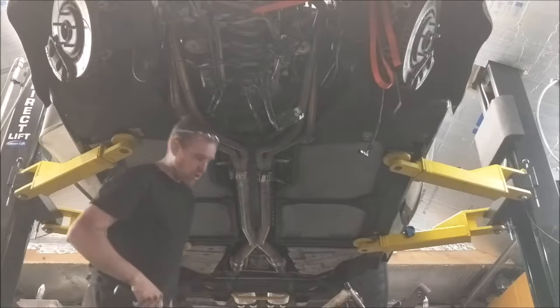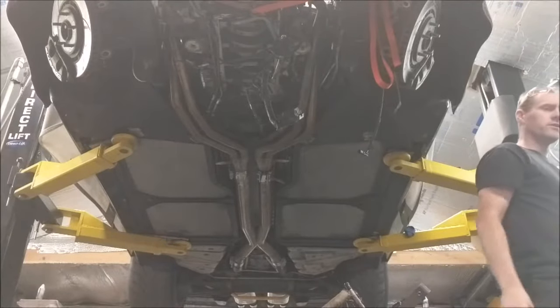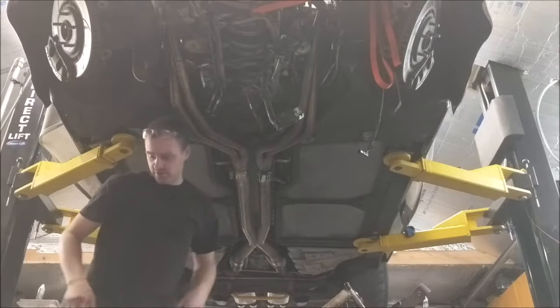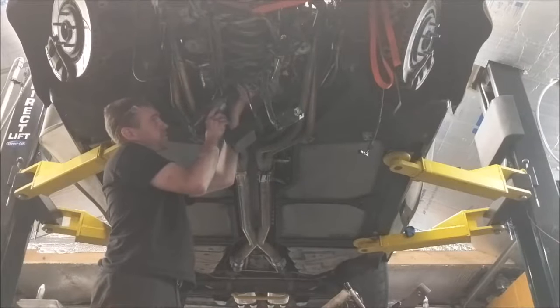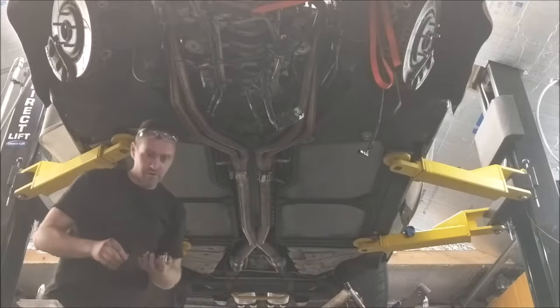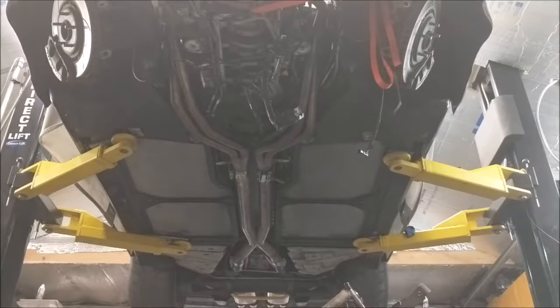There, you can hear the difference in tone, hopefully. When they do separate, it changes the tone of how it sounds when you hit that. So now it's separated. Now all I have to do is take the bolts out the rest of the way, and that cap will pretty much fall off of it. Okay, the cap is off. We have a rag so I can show you the bearing surface on this end.